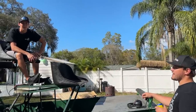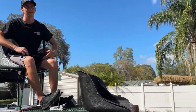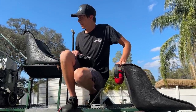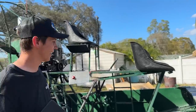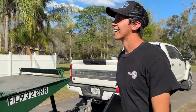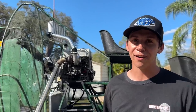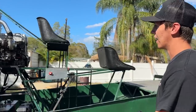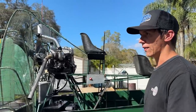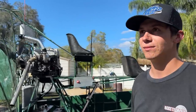We're jumping a couple videos worth of content by going right to boosting it and turning it up, so hopefully we don't blow it up on the first day. We should probably slow it down a little bit. We'll take the wastegate apart when we get there. It's running good other than that - freaking ripping. Old Skippy coming along. So many people said it was not going to work, and there were comments about the intercooler being inefficient and in the way of the prop, but I really don't think it's going to be a big deal. The engine was only getting to 160 degrees with the radiator down there - the fan is pulling so much air through. Let's go see if this thing floats.